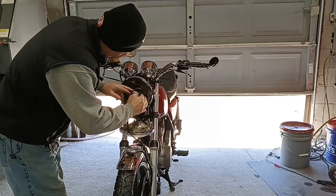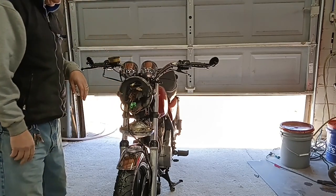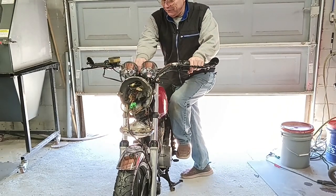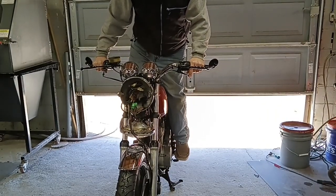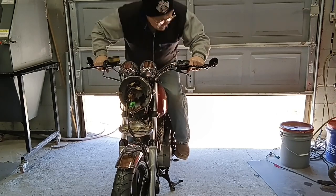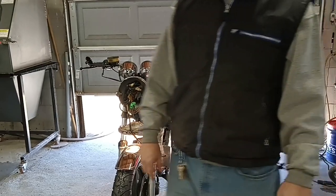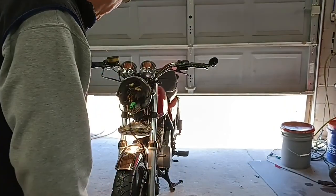If I can locate the turn signal wires, I may test those out with a test light, just to see. But first, let's crank the old thing up and check the headlight switches and the horn. Bring it up on the compression stroke. Release the compression lever. And kick. Don't be shy about kicking these things. They need a good hard prod to get going.